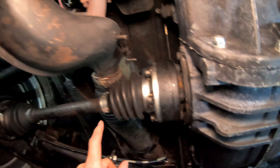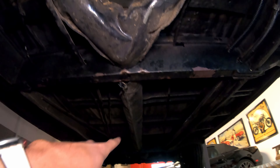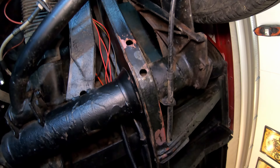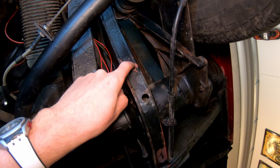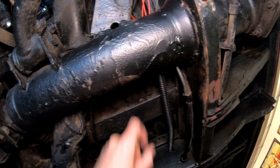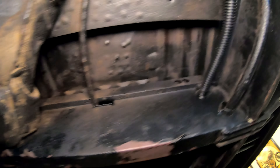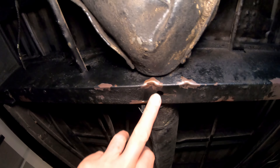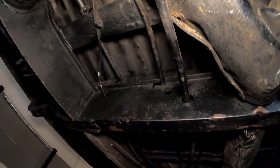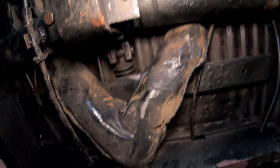The heat exchangers come forward — two of them together into that center piece and forward to the cabin. In terms of rust treatment, it's really important to try to spray into all these different holes and cracks. There are a lot of access points that enable you to get wax and rust treatment into the vehicle. It's a really worthwhile exercise because these box steel units can rust out from the inside, and by the time you see it it's too late.